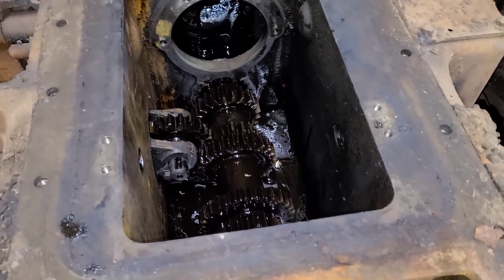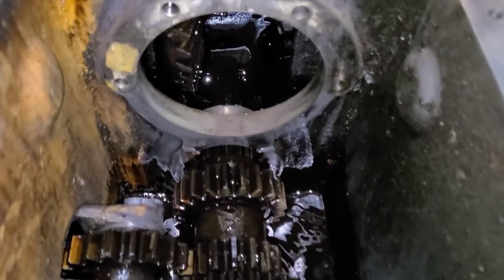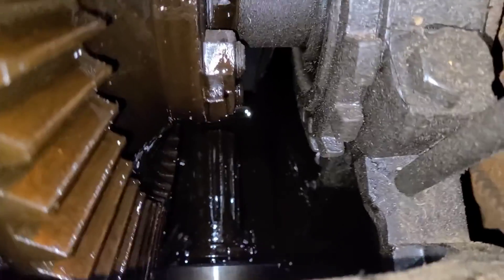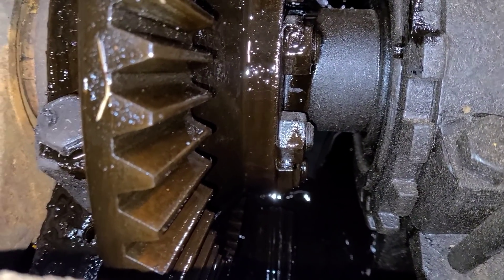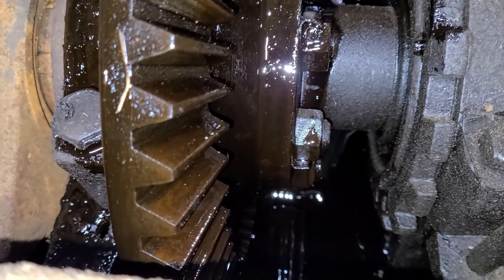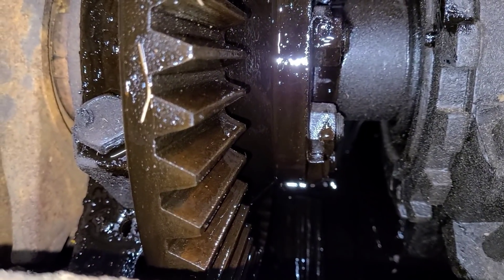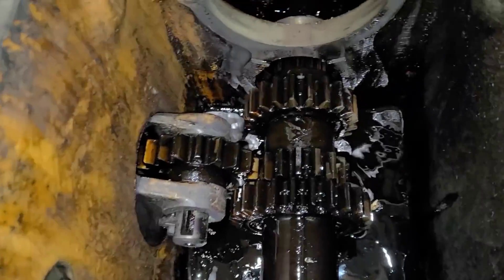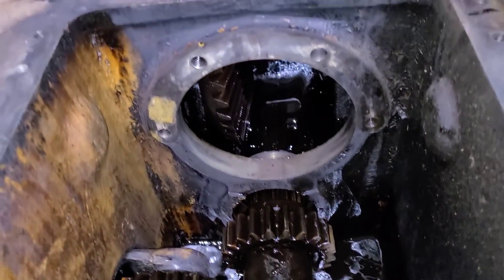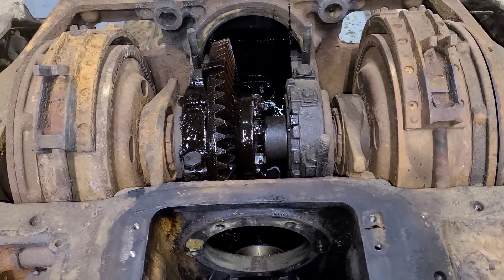Not to dip out on the transmission here, but if you actually look where that counter shaft goes all the way through the back there, we end up below the ring gear for the ring and pinion. The pinion's gone, obviously — that was on the upper shaft. I do think it would be a lot easier to bring that shaft back, because we have to pull all of these gears off in order to get them out. So I think the next step is pulling that whole shaft out of there.